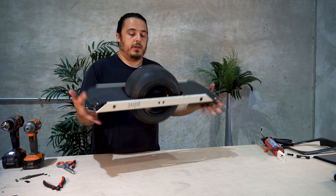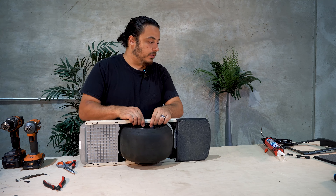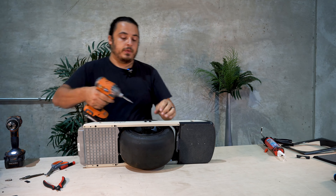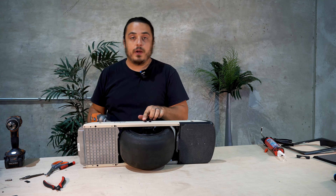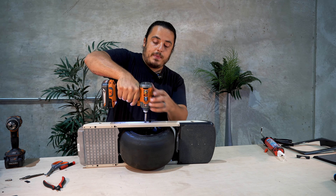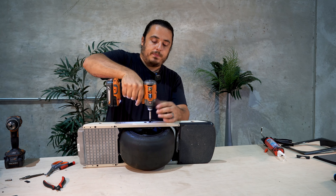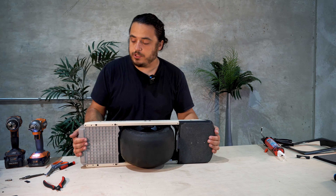Once our enclosure is in place, now would be a good time to reinstall the axle nuts. We're going to take our two bolts and thread them both individually first, because if you put one in and it's unaligned, it's going to be really hard to get the second one in. Tighten these down a good amount until the impact driver stops spinning. Some thread lock on these also is a good idea, but enough torque usually does the trick.